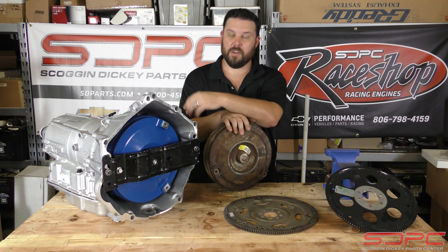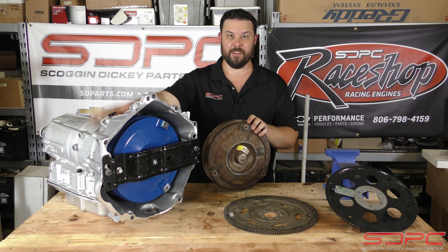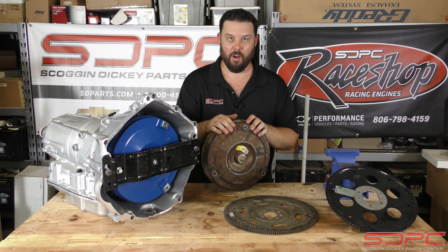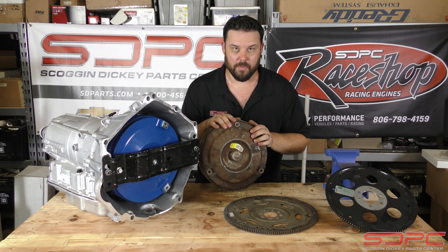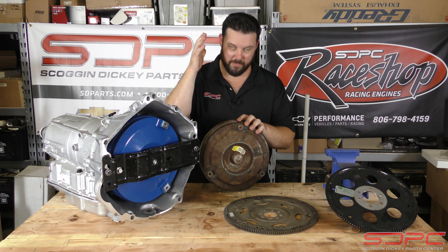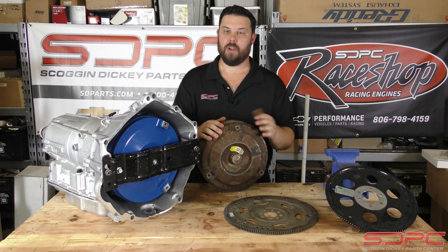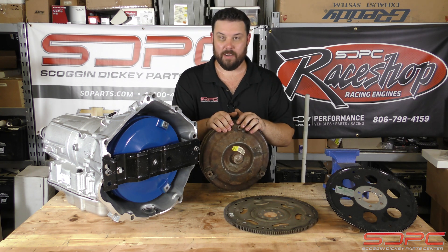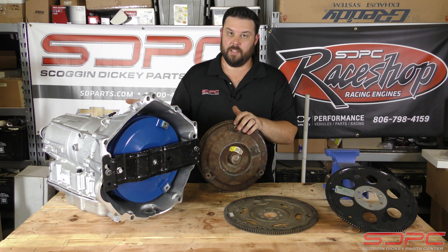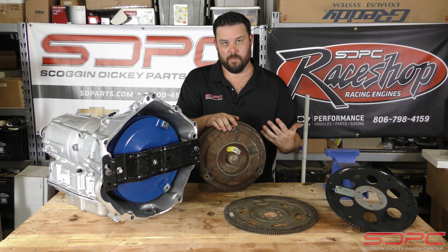Personally, I think that's where most people have more problems. This stuff is heavy. I have crawled underneath a car on jack stands and tried to hold one of these on my belly and chest and try to stab it into a car, all while making sure the torque converter doesn't fall out and all while that stinky transmission fluid is running down my leg. I feel your pain if you're watching this going, I hate messing with this stuff — I get it. But you do have to do it right, or all you're going to do is pull it back out and it'll cost you thousands to replace. Remember, warranties don't cover misinstallation. It doesn't matter if it's Chevrolet Performance or an aftermarket warranty — nobody covers that. So you've got to do it right the first time.